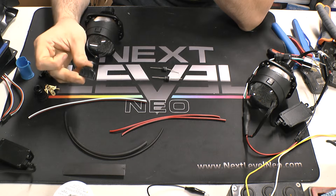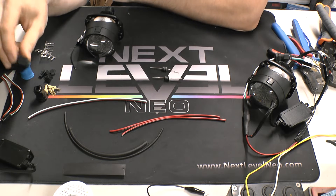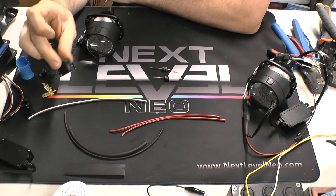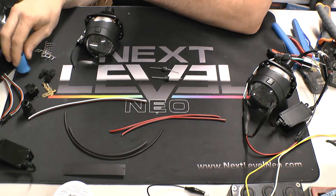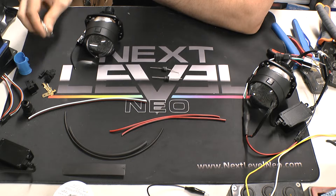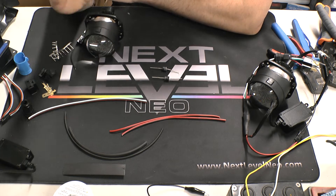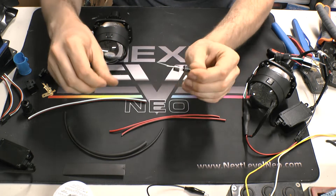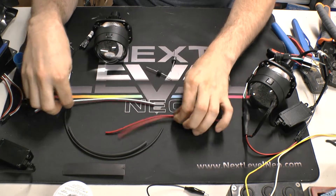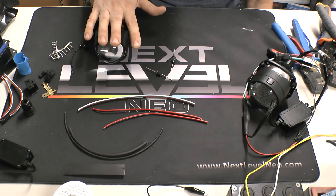Obviously you're going to have to have the plug that matches your car. You can get versions of these that are already wired up, or you can get kits like I do. I like to crimp my own — I get the pins and the plugs and make it all. I also have these which I don't do nearly as much as the H4s. The key components you're going to need are the diodes. You do need two for each light, so you'll need four total for a set of lights. And then your basic wiring and shrink tubing — that's the guts of what you're dealing with here.